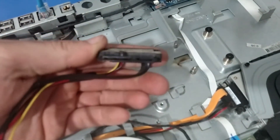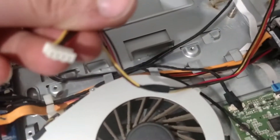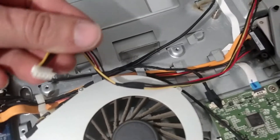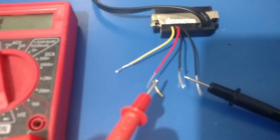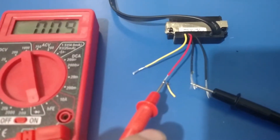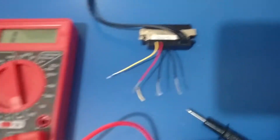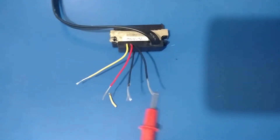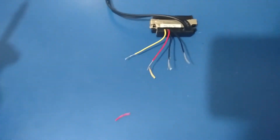You can see the bottom of this is just melted — the weirdest thing I've ever seen. It just melted right down there. So I just have to replace this. It's just a SATA on one end, so I'm going to cut this and splice it onto a SATA power cable. I'm reading continuity to the black wire. The red wire is the 5-volt wire and the black wire is the ground. You should never see continuity between those, or there's a big problem.